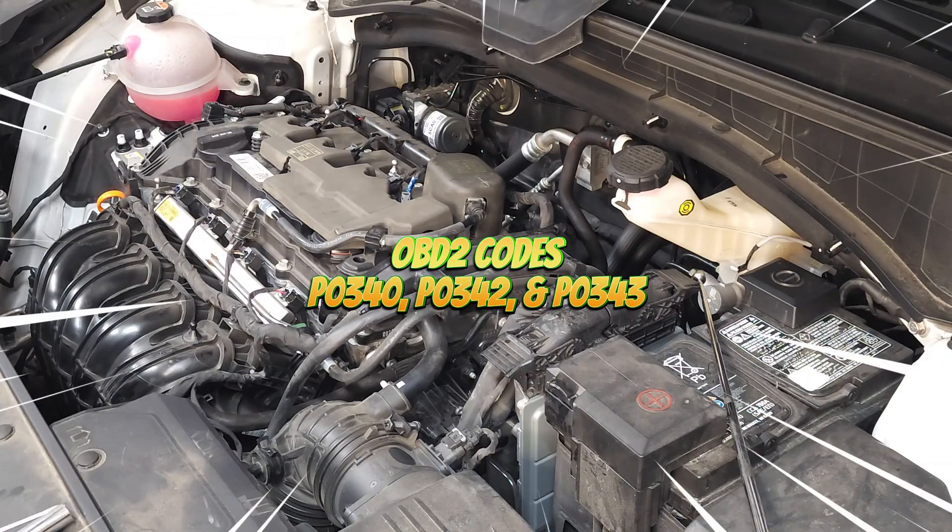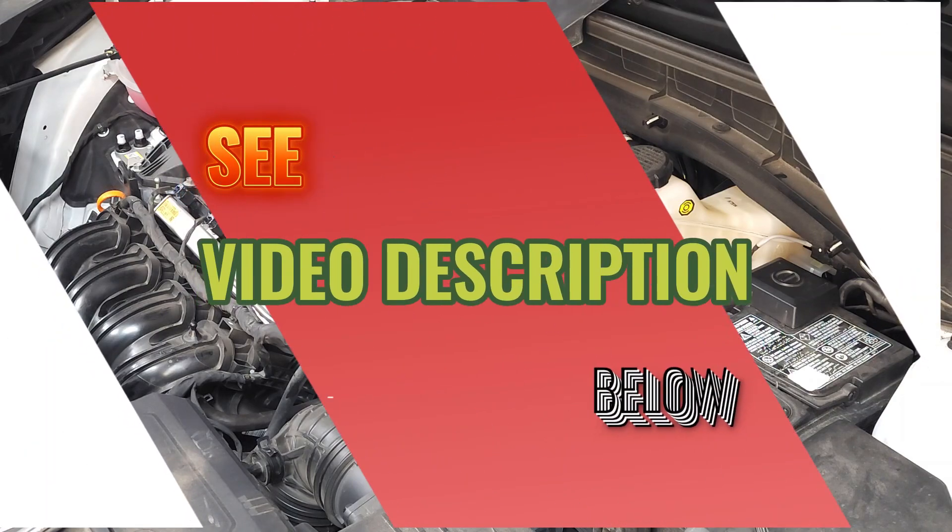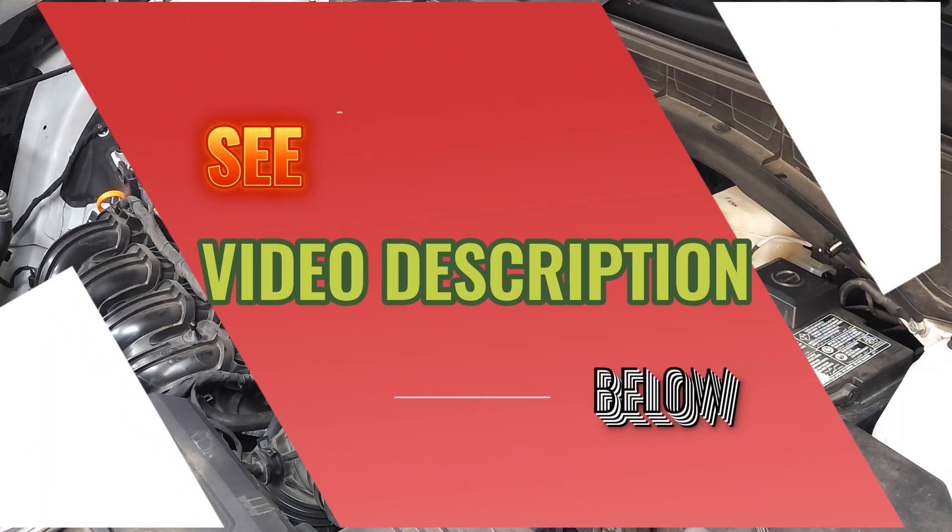What does this part do? It works with the crankshaft sensor to define the exact position of top dead center of the crankshaft cycle. Our supply list includes two sensors — I recommend that if one sensor goes out, you go ahead and replace both sensors. You can easily find them in pairs online or at the dealership. If one is worn out, chances are it'll be a short period of time before the other goes out. You need a 10 millimeter socket, a small flat tip screwdriver, and it's possible you may need to change the engine oil and filter.